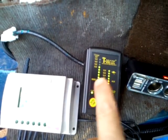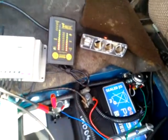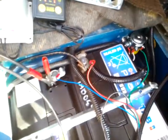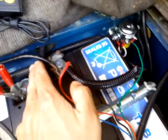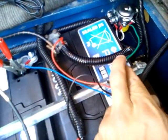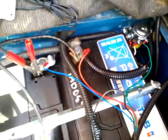I've got the starter battery and auxiliary battery labels a bit confused — the starter battery is on that side and the auxiliary on that side, but it's the opposite way around on the T-Max controller. Anyway, I've gone on for about six minutes — hopefully this video proves useful to anyone looking to fit the T-Max system. It's fairly straightforward; we crimped the main connections rather than soldering. I must admit I haven't put the fuse on the green wire yet, so that's the next job.